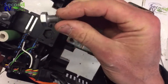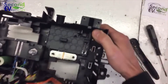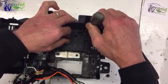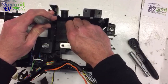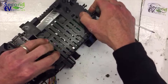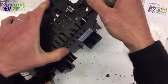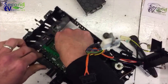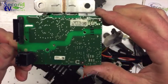These bolts come out but aren't that helpful — let me try to get the PCB out, which I think is more useful. Interestingly, we see this in the Mitsubishi Outlander, the iMiEV packs, and the Nissan Leaf packs as well. They all have these little circuit boards that control the pre-charge. I'm not really sure how we can repurpose them unless we can control the CAN bus.